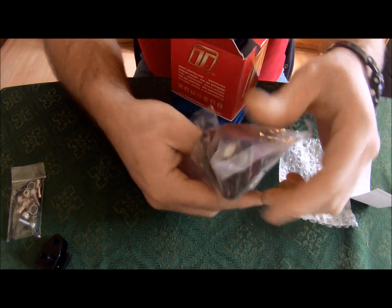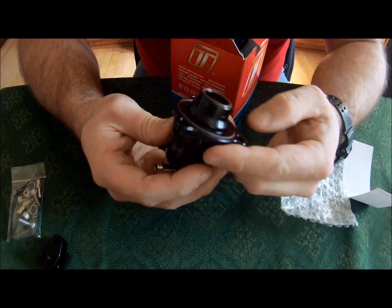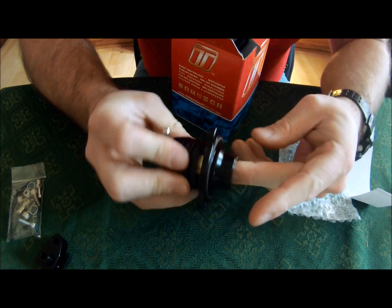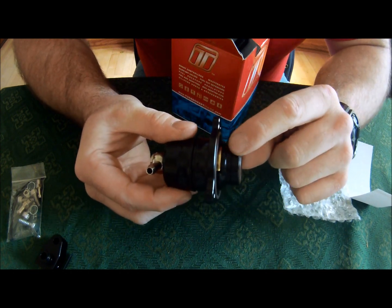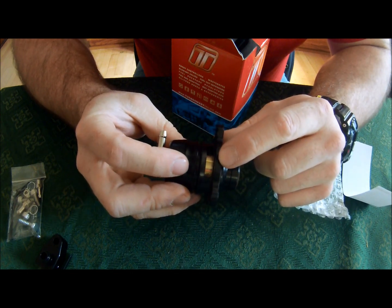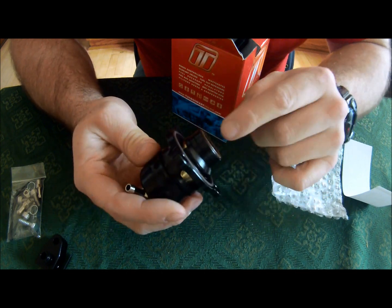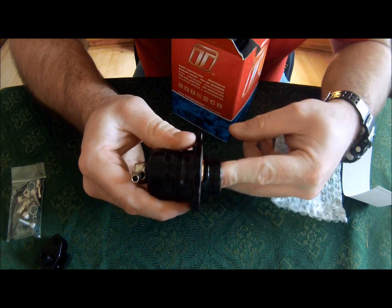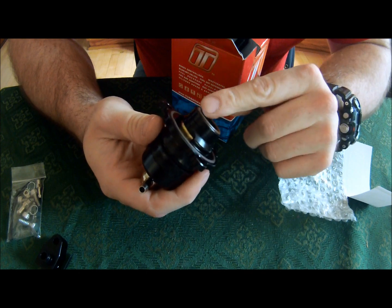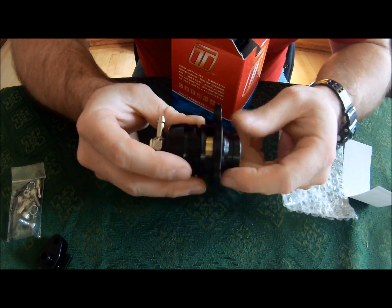The actual unit — let's have a look at this. Pretty solid construction. It's really exactly what I was expecting from the picture. Here's the port for the recirculation and then the port for the vent to atmosphere. What I assume is going to happen is under low boost it's just going to open up a little bit and only do a recirc, which will probably be a lot quieter. At higher boost it'll open all the way and vent to atmosphere, giving us more of a chirp noise.